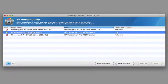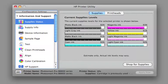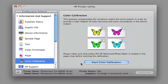If I go back out and select the 8850, one tool allows me to control all of my printers. I can see the supply status, device information, and again, I can do a color calibration or a closed loop calibration, as I call it from HP, on these smaller 13 by 19 printers. And if I have a calibrated display, I now have a calibrated device and I have a color workflow. So I've set up all of my printers.